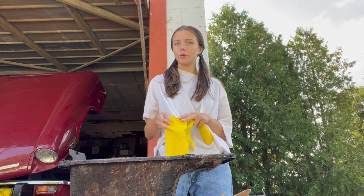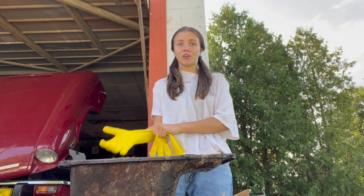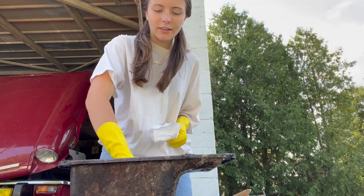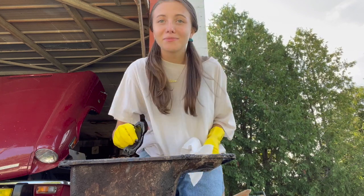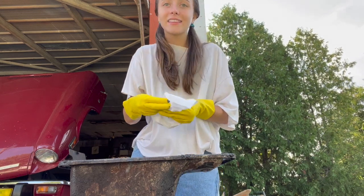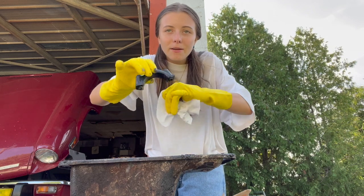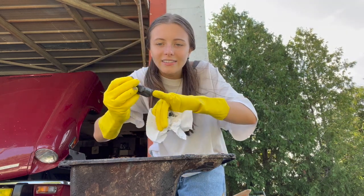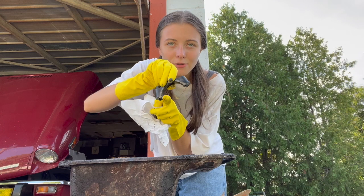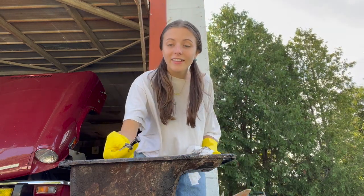I want this all cleaned out so we can see what's inside. I'm going to take everything out and clean it off — but first, rubber gloves. I'm going to wipe it off with some paper towel to get as much oil off as I can. This is the part of the connecting rod — I'll show you once it's a little more clean. This side is empty but this one has a bolt that is sheared off and broke right here, so that is no good. This is supposed to be a semicircle but as you can see it was stretched out and pulled open. Done — replace it.